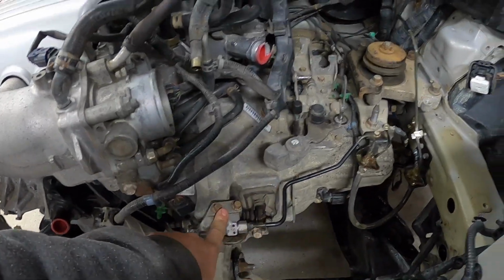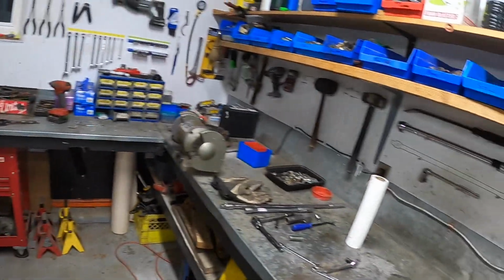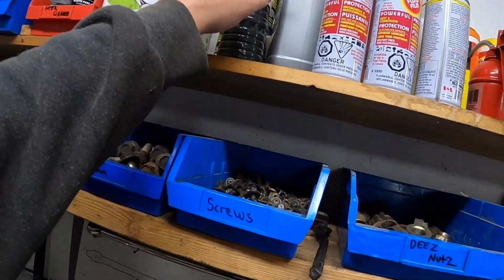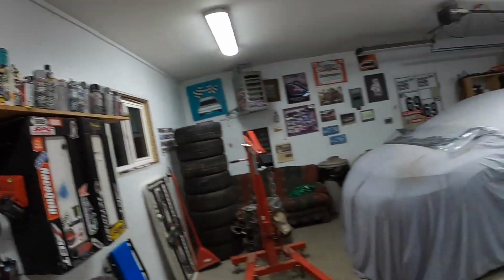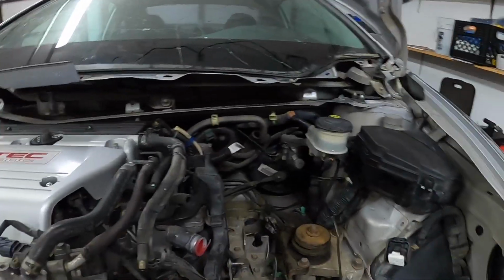And if so, then we will continue with bolting the rest of the crap back on this thing. All right, the clutch is all installed. I managed to bleed it by myself. I just used my little bottle or the hose method and pumped away. You can see it's pretty dank fluid, but got her bled out good, fully flushed.